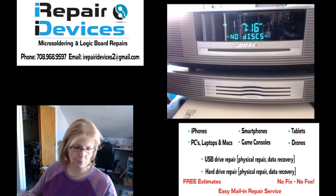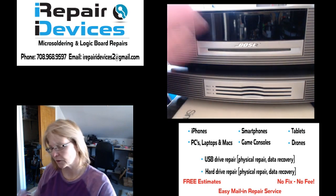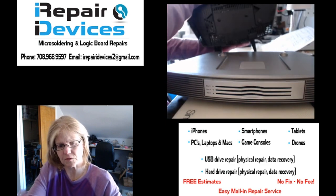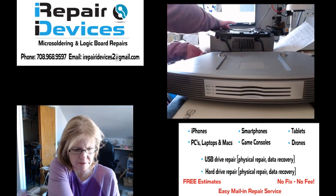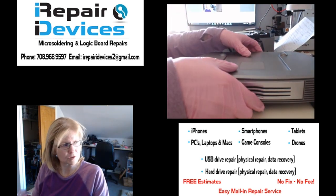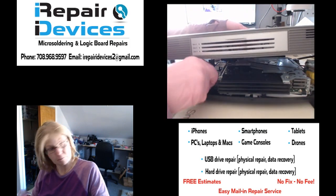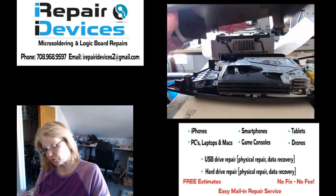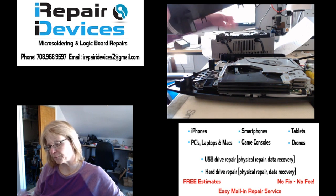So what I'm going to do is just disconnect the power. This is actually two units, so I'm going to flip this top unit back — I'm still going to keep it connected to the bottom unit. I already removed the screws from this bottom casing, and I'm just going to disconnect the cable here. This ribbon cable transfers signal to the LED display screen up there.